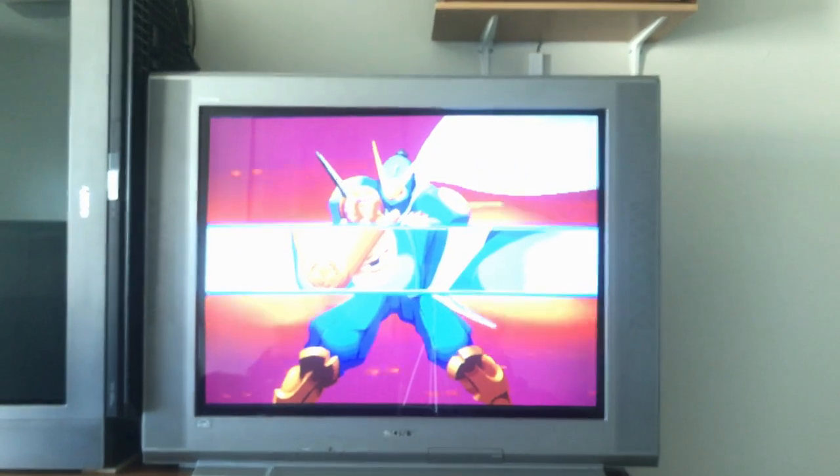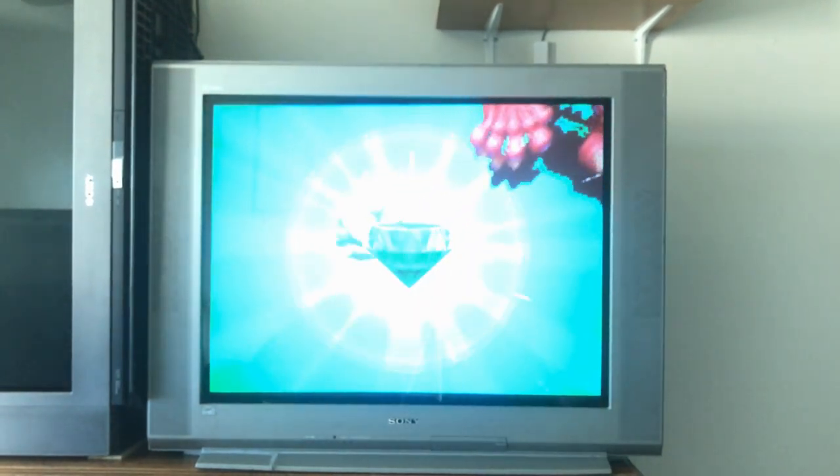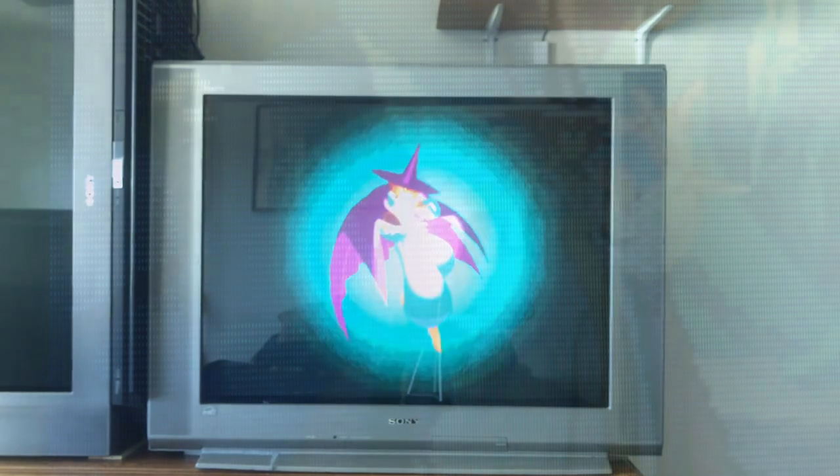Let's check out the scan lines here. We're in close — you can also make out the mask of this tube because it's a 36, so you're not meant to be this close to it. On a large CRT like this you can see the mask because physically it's so large that when you get this close you'll see those vertical dark lines — the pixelated look — but at a normal viewing distance you won't see those.